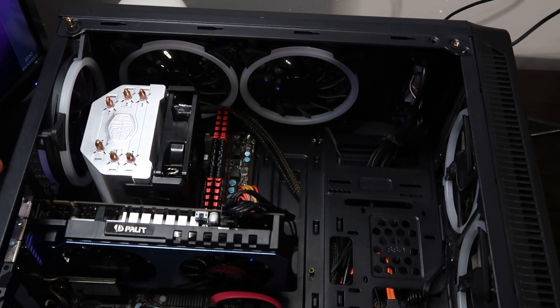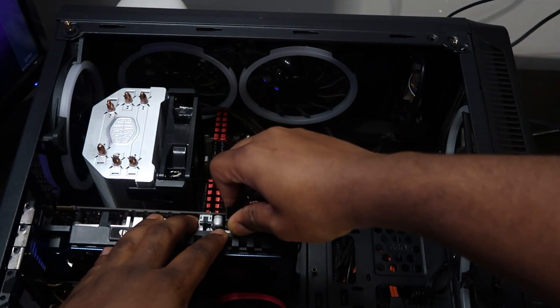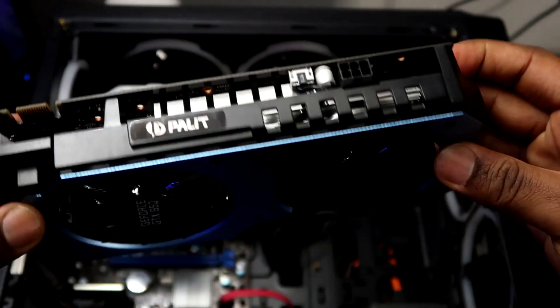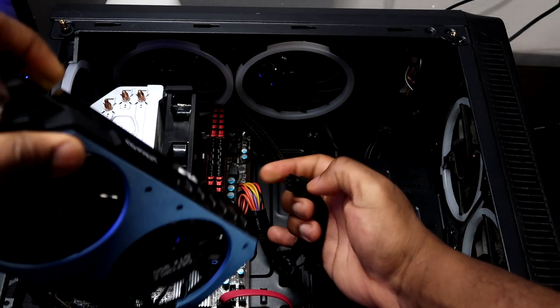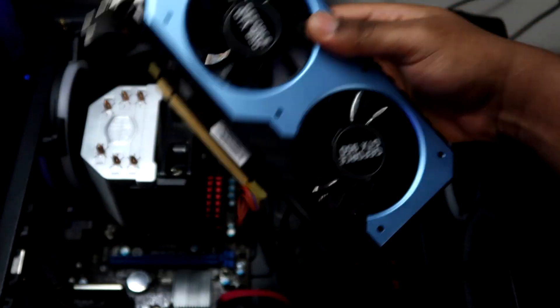Another thing you can do to check a no signal fault is remove your graphics card and make sure everything is working properly. Some graphics cards have six or eight pins connected to the power supply, and a lot of PC builders might not have the correct conversion — a six pin to an eight pin sometimes works, sometimes it doesn't, but it's better to be safe and get the correct pins for your graphics card. Take the graphics card out and check for dust. Try it in a different system to see if it gives a display — if it does, your GPU isn't the problem. Better yet, try a different graphics card in your system to confirm.